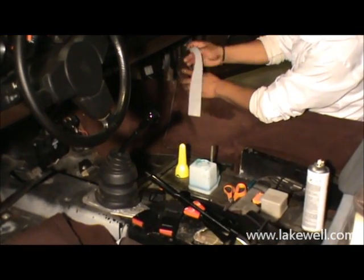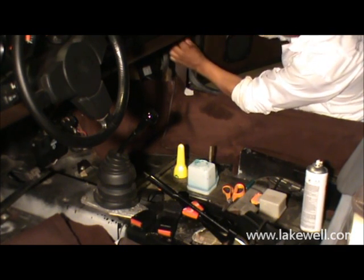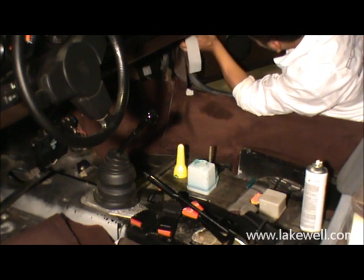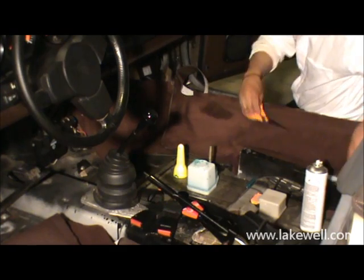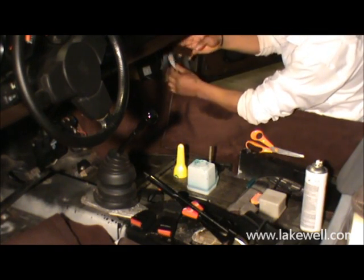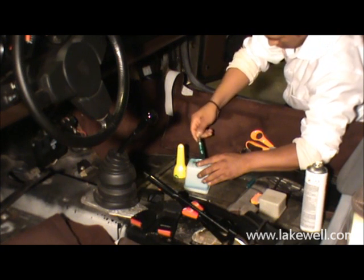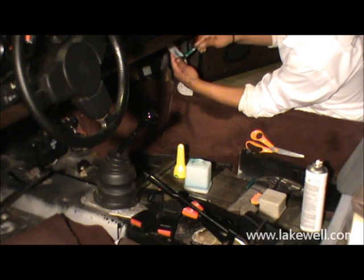Okay, now for the sill carpet piece, we're going to be gluing on the front flap to the A-post. For this we're first going to measure up the tape. So you see that Robin cuts it all the way to the point where it meets the dashboard, the lower piece of the dashboard, or more precisely the knee protectors. He's now applying some glue.